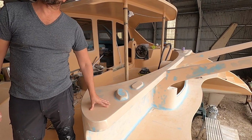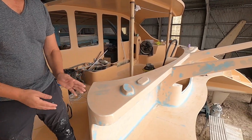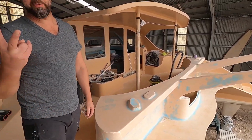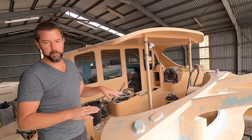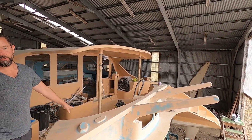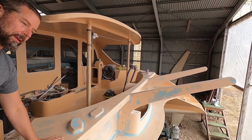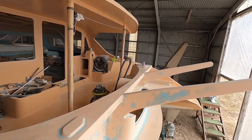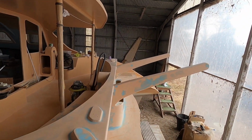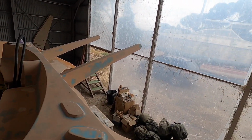So we are looking for a primer that's a slightly different color than this beautiful pink orange, for several reasons. So there's an advantage with two primers, because then you know how far you've sanded. The pink is ugly enough for you to notice when you've sanded out through the next primer, which is going to be a light grey. And then we'll see what other minor imperfections we can find, if there are still any in between layers. Light sand after the next layer.